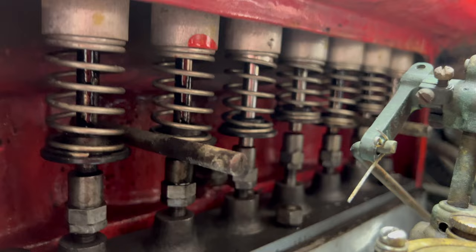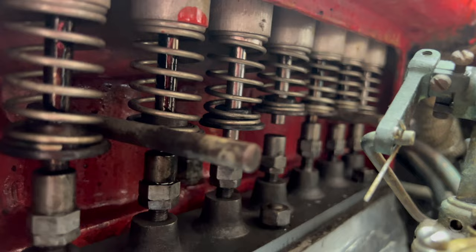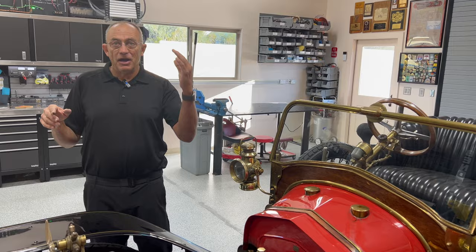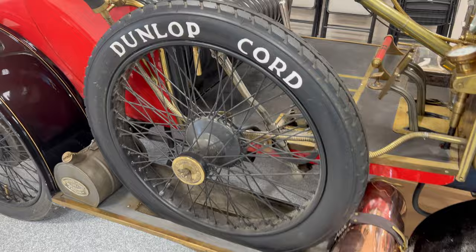I'll take out all eight valves, clean and polish the stems, put them back in, and the stuck valve situation will be gone. The lazy valve situation — two that were lazy on the return, not even fast enough for starter speed at 400 RPM, certainly not for 2,500 RPM — I'll polish those two. I might also order the next size diameter coil spring for another five to ten pounds of tension. This may be why the RPM is limited to 2,200 — maybe I'll get another 400 to 500 RPM with everything running right.